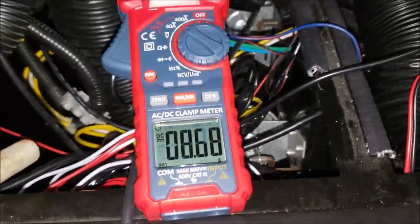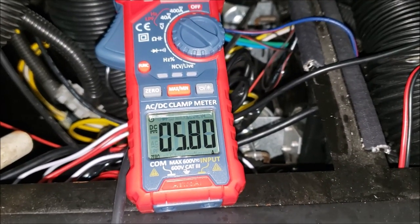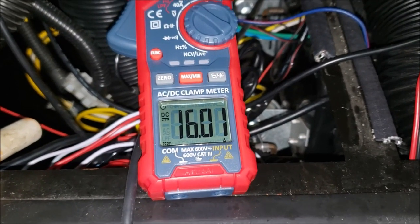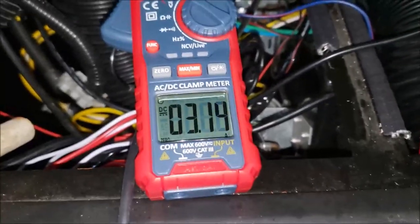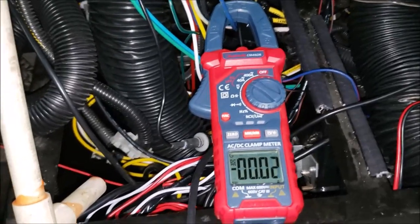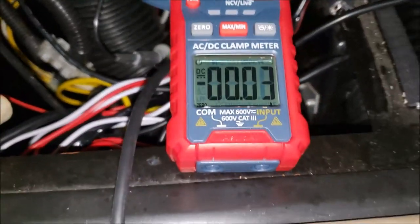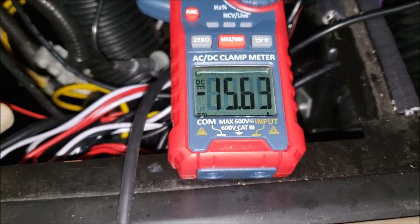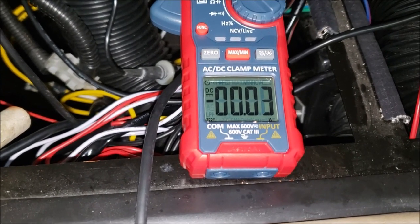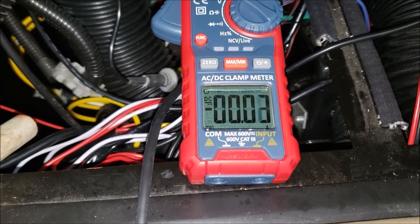You can tell when you change your speeds — of course it drops. Down to about 3 amps on the lowest setting. So I think I'm now figuring out why we have two fuses on this thing. This solid blue wire — notice when we get on high we're at about 16 amps, but as soon as we go to lower settings it drops off to nothing. So that wire is only energized when you're on full-speed high.